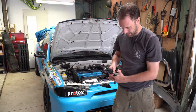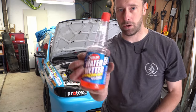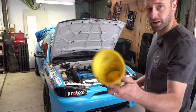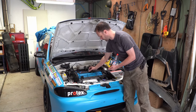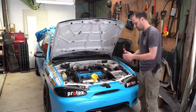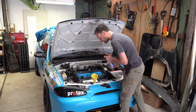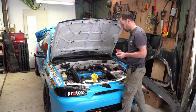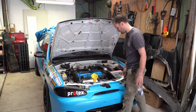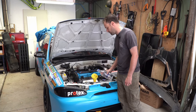So we'll fill it full of coolant. Obviously there was still a bit of dirt left in that old block, so she's pretty gross — we'll be filling that with some fresh stuff. Luckily I had some Redline Water Wetter left over, which is great. These little funnels are the greatest thing ever — they're funnels that fit properly into radiators, about three bucks online. Just pop the cap, put it straight in there and then you can go for gold. Make sure all your hoses are all done up. Pour the water wetter in and the rest is just water — preferably filtered, distilled water, because you don't get the impurities that come out of your tap.